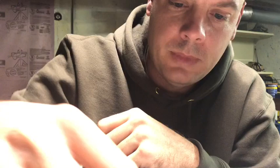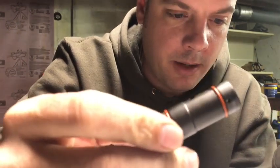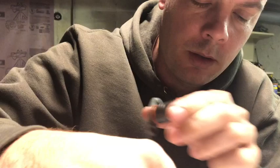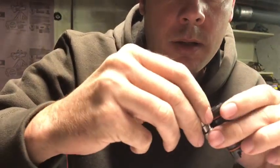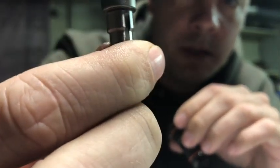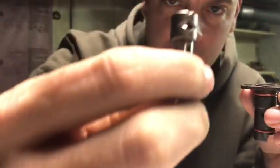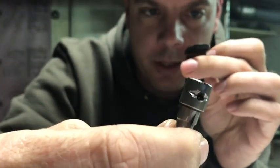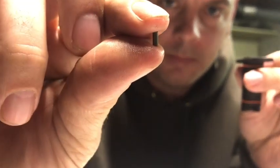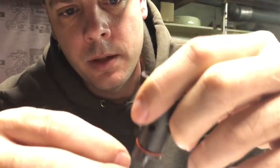For the assembly of the barrel, plunger, and housing, I use a little bit of oil or diesel fuel on the O-rings. You have a small pin that goes into your barrel holder. If you look at the back of your barrel, you'll see there is a line just above my finger that has been machined in — basically what that does is it aligns this barrel into this holder so that it will not turn. The pin, if you take one of these apart, is very small.